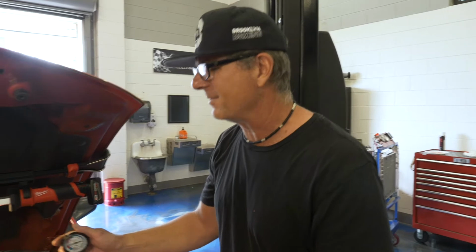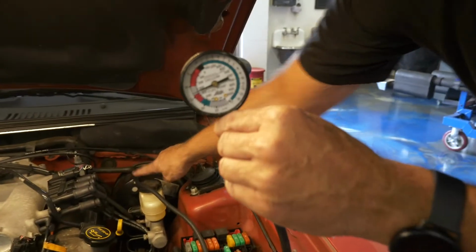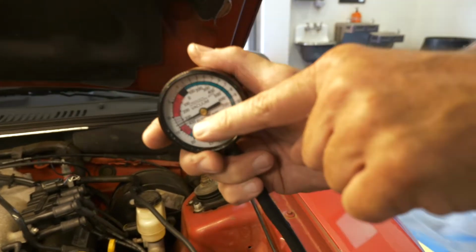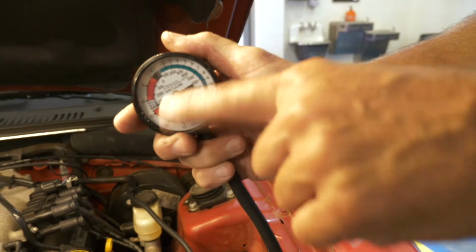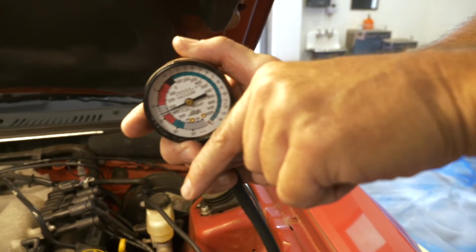Perhaps you got an engine problem, mechanical integrity. You can take a vacuum gauge reading. I got it hooked up to a source right here of intake vacuum. What are we looking at? 15, anywhere to about 25 inches of mercury. That's good, holding steady. What if it was flicking? That would be a valve problem. What if it was steady and low? That would be an intake leak.